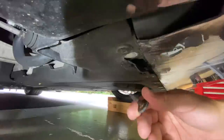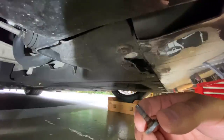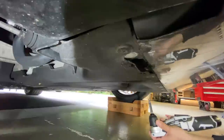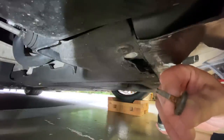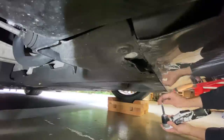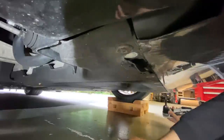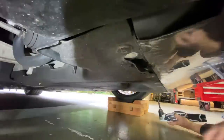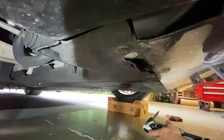Check to make sure there's no corrosion or thread issues — fix the threads or replace hardware as needed. You can also put a little dab of copper or silver anti-seize on there for corrosion resistance, because these things do corrode. I can see there's rust on the ends, so I'm going to soak these in Evapo-Rust before reinstalling. These are about six to eight dollars each from the dealer, so you want to make sure they're in good shape. I'll pull the panel off, clean it, and then go through the oil change process.